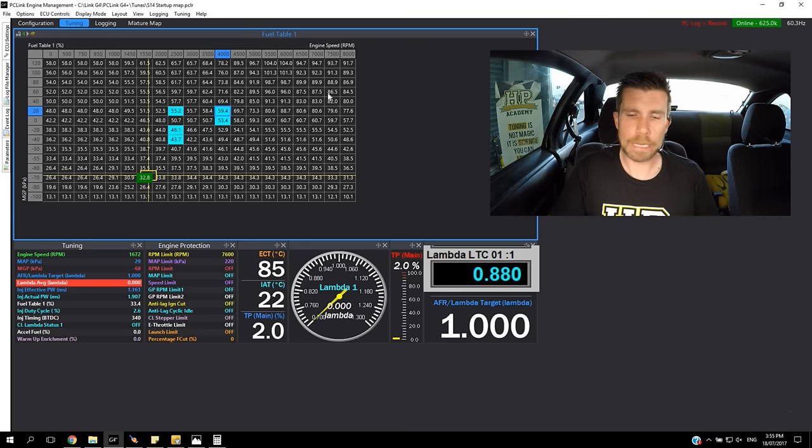This is a much safer way of tuning. When moving into untuned zones we do need to be a little bit sensible about how we approach those. The tuning envelope is a little bit tighter on a turbocharged engine in terms of giving the engine a safe air fuel ratio and safe ignition timing. So if we tune a zone, increase the load and find that the air fuel ratio is lean, we're much safer to drop the throttle, come back out of that zone, add some fuel, and then go back and have another look — rather than sitting there with the engine running leaner than ideal while we slowly increase the fuel. Likewise if we move into an untuned ignition zone and the engine starts to suffer from knock, we're much better to reduce the throttle position, get rid of that knock, reduce the timing and go back and have another look.